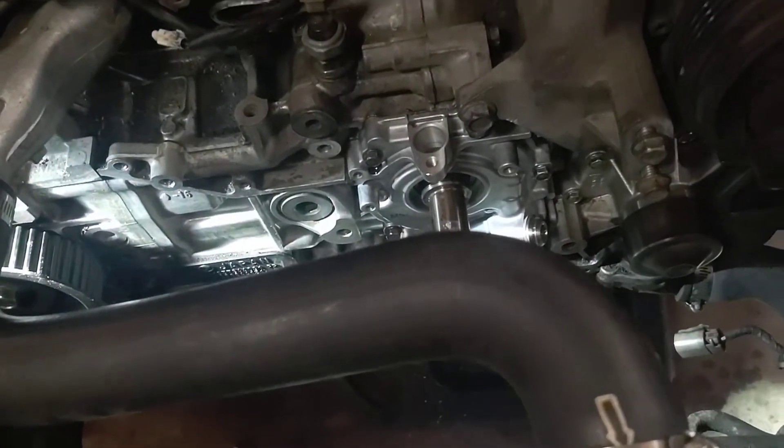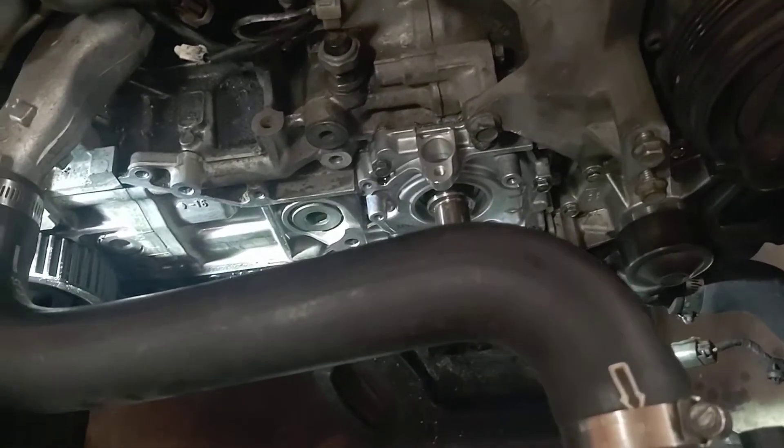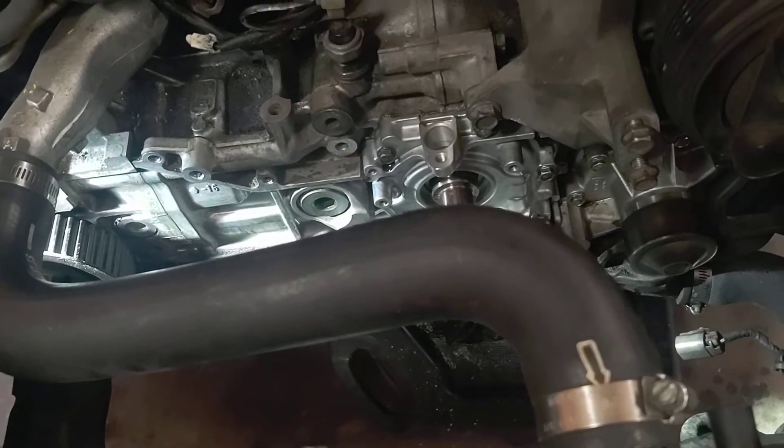The general cure wait time is 24 hours. Now that I have it seated and torqued down, I cannot put oil or any other fluid that will come into contact with that gasket maker on it for 24 hours.